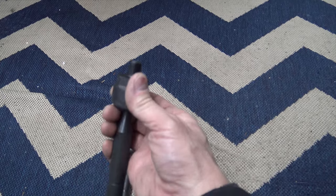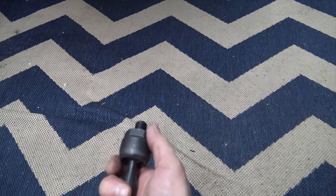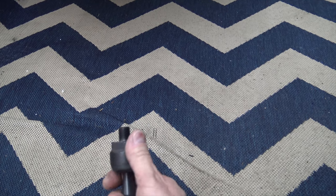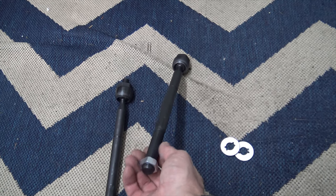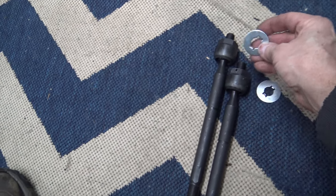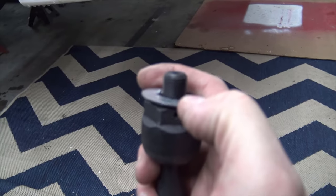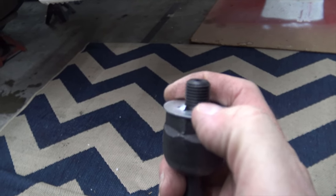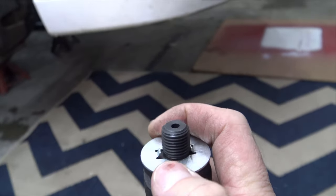I think left and right are the same. The inner tie rod is what screws into the actual steering rack, and then it connects up to your outer tie rod end. The kit came with two inner tie rod ends and also these two little lock tabs. They go right over the nut and once everything is bolted up you flatten down the edges so it can't come loose — it's sort of like a lock.